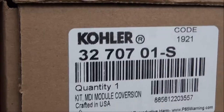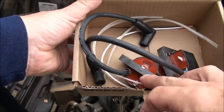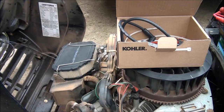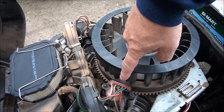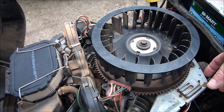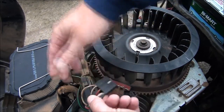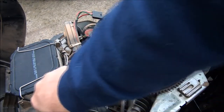I got this kit from Kohler — apparently this is the part number. Looking inside, it comes with a couple of brand new coils or magnetos, a little wiring harness, and thank goodness some directions — they're not written down very well, but I think we can figure it out. First thing is just to remove these coils. They call this version the DSAI module; apparently there's a DSAM module setup too — I think those are the ones with the separate spark advance unit. For this one we're just going to disconnect the wires and take the old coils off.